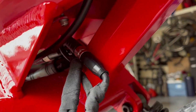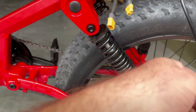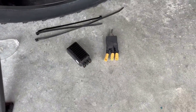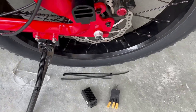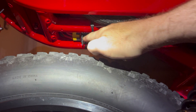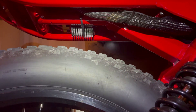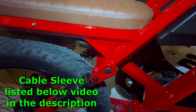The connectors are attached to the factory wiring and out come two XT60 connectors. This cable here is for the auxiliary battery — I'm going to put an XT60 onto that. It runs into the battery box and then I will attach either the battery combiner or the homemade three-way switch. I'm going to try the battery combiner and tuck everything underneath the space under the seat. Looking under the seat you can see the battery combiner; the cables run back underneath the seat and up into the front. I did have to loosen the four bolts under the seat to route everything neatly, but from the top, using a cable sleeve, you can barely see the cable harness.